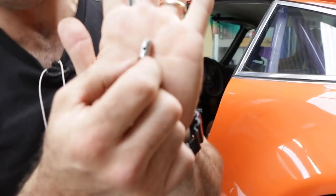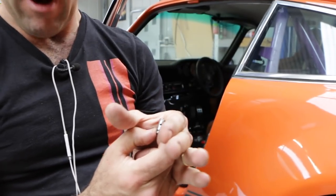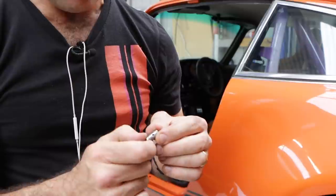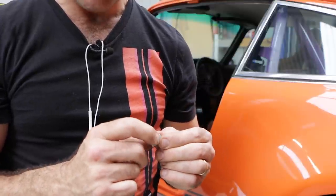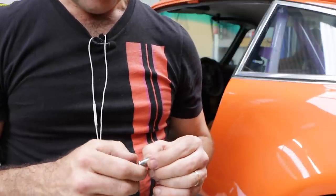I went and had a look at why the clutch cable snapped. Basically the issue was I'm using this tiny little fitting where you stick the cable through. It's held in by a U-bracket on the pedal and that pulls it tight. I'd tightened up the bolt on the end so far that I'd twisted it around a couple of times, so I was pulling it on an angle and using the sharp part of it — that's what did it. I overstressed and over-tightened it. I'm going to try and do it without actually stressing it. I've got a bit of extra length in the cable, so I'll retry using it at least for the time being — it might be good enough for a temporary solution until I can get something else.